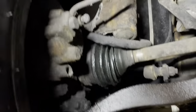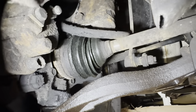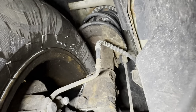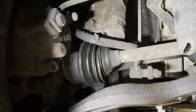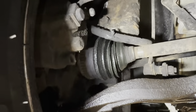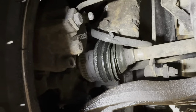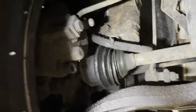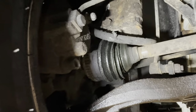As I'm taking a closer look, I find the outer boot for the CV shaft — the axle shaft — is torn apart. And I notice this guy sitting up here too: that's part of the coil spring from the strut. It's actually broken off the seat and pushed down past the seat of the strut. So that's why I'm recommending two struts, lower control arms, and the axle shaft. The axle shaft — you could maybe get away with doing just the boot, but I'm going to have half of it apart anyway, and I can get one pretty cheap, maybe like 50 bucks off of Rock Auto. So it's worth just replacing it while we have all the suspension apart.